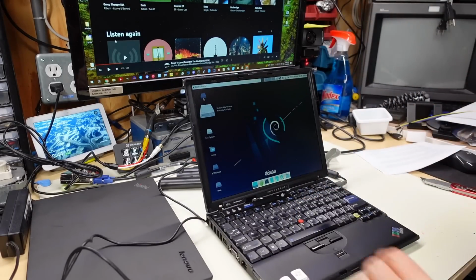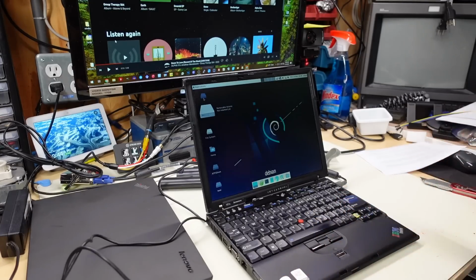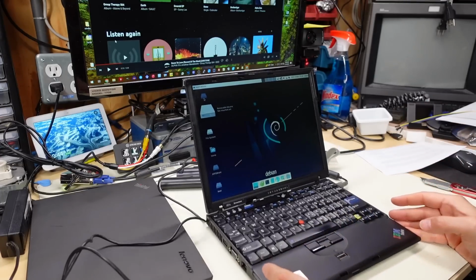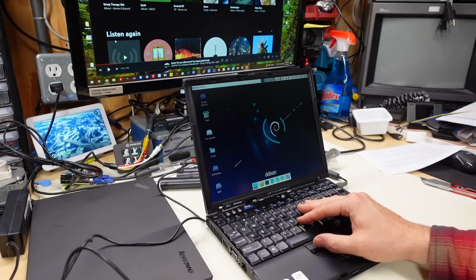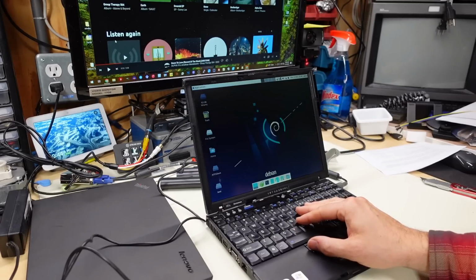All right, one thing I can tell is this thing has a solid state drive in there because it booted up very quickly, and I don't hear the hard drive spinning. So it has a SATA solid state drive in here, not NVMe or anything like that. This says removable volume, not mounted yet, so that's obviously the Windows volume. This one up here, NTFS share, boot.